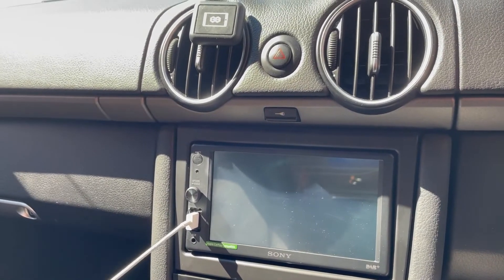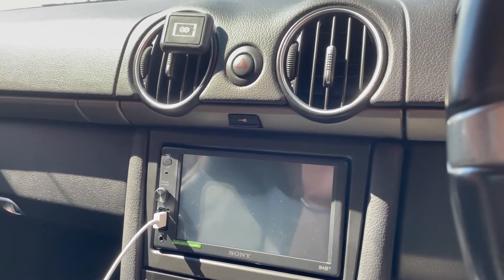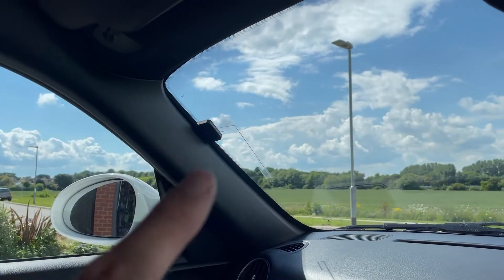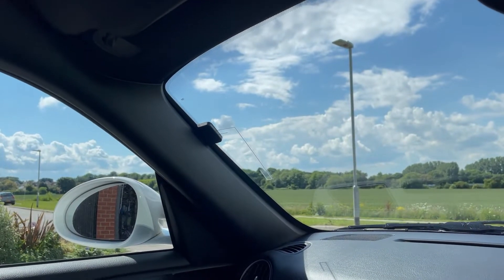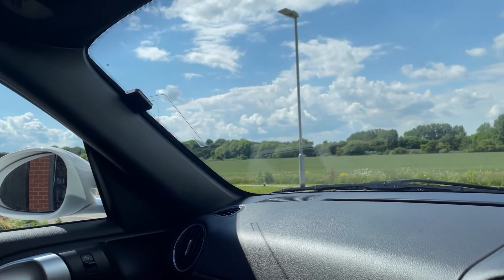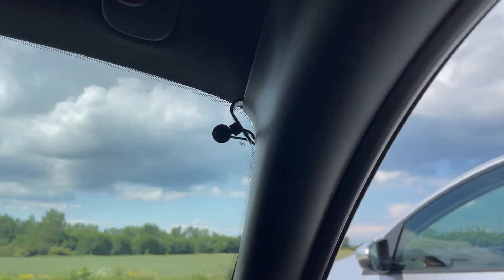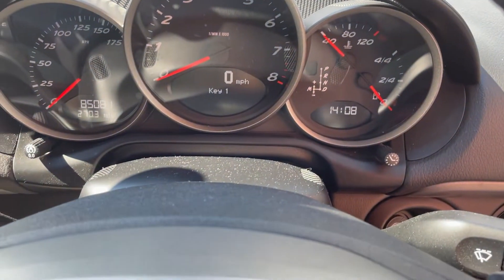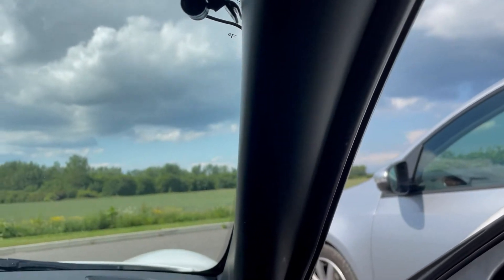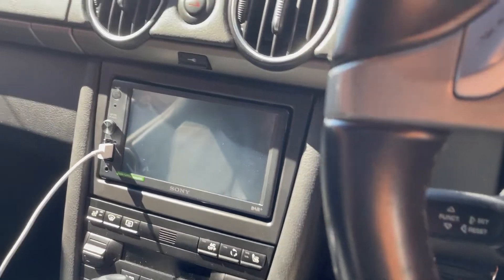For CarPlay you do need a USB cable connected, so it's not completely wireless. The DAB aerial is up there — that's probably the trickiest bit, getting that A-pillar cover off because the cable goes right back to the rear, which was a bit awkward. I ran the cable down the side, behind the glove box, into the back of the unit. The only other thing I don't really like is the microphone — I couldn't figure out a way of using the car's standard microphones — but that works too, running down the A-pillar underneath into the back of the head unit.